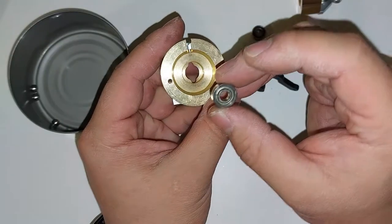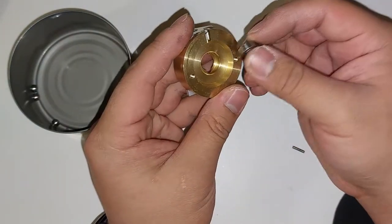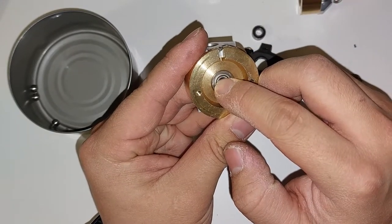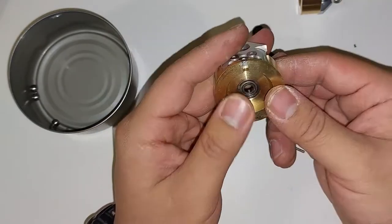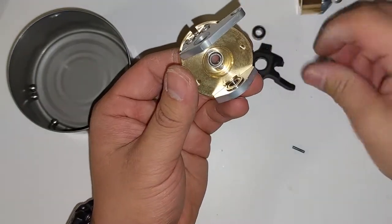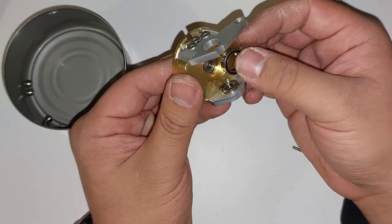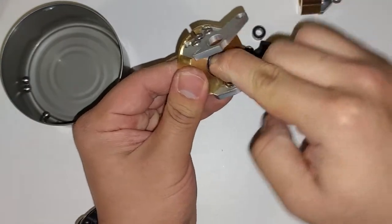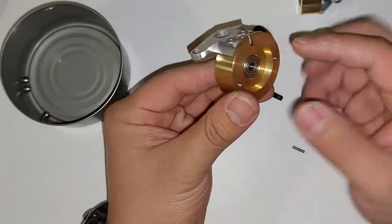So definitely go ahead and order some rubber sealed ones, but essentially this goes into here. It fits relatively snug. It's got a little bit of wobble in there, but it's better that than if it got stuck. And you'll also need your stock inner bearing for your output stub shaft for your universals or dog bones, and it fits snugly in there. It's pretty nice. And yeah, that's basically the knuckle assembled.